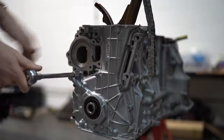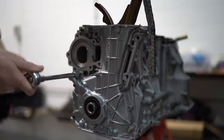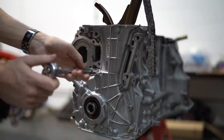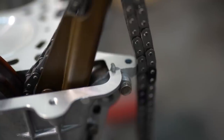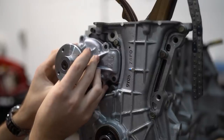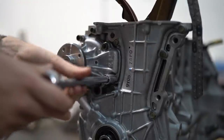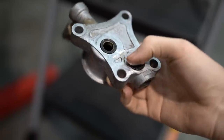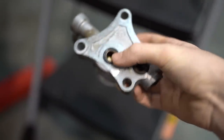Don't go in a circle doing bolts up — try to go from side to side so the pressure is applied evenly. Then wipe off the excess silicone left on the top and bottom. While I'm working with the silicone I might as well put the water pump on the front and also my oil block on the side. The oil block actually bolts up without silicone as it's got little seals that seal the oil passageways.